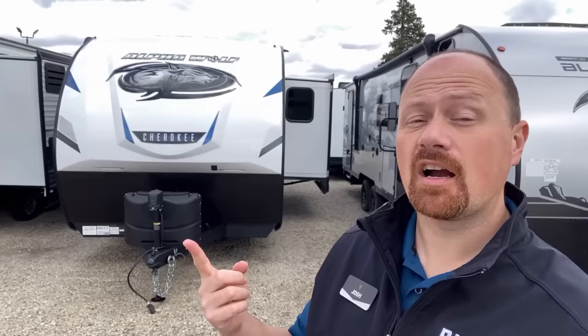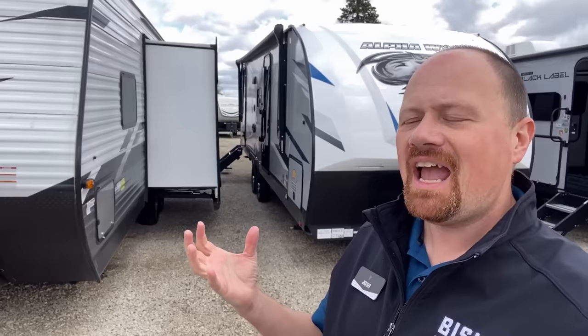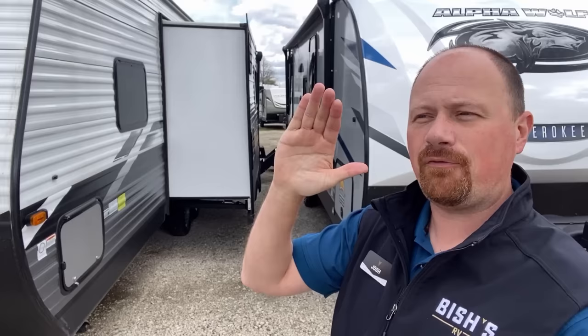Another major tip: never leave a slide partially open or partially closed. If you want to raise blood pressure around RV professionals, walk around and leave a slide halfway out. When the slide is in the process of opening and closing, the seals aren't fully engaged. When a rack and pinion floor-flush slide opens and closes, it lifts up a little bit so the corners aren't fully sealed, and while those wiper seals are wiping in and out, they have to flip — and halfway through the flip they twist, and at that pinch point, water can seep through.